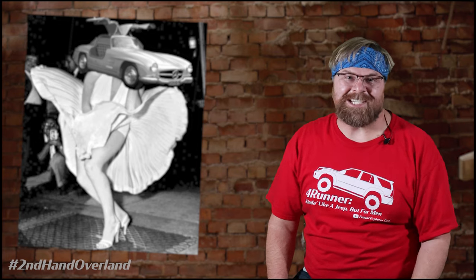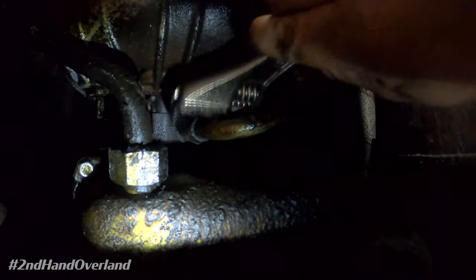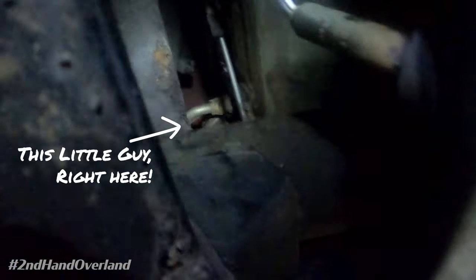Here's where things got interesting — disconnecting the lines from the transmission. You're going to want to keep the drain pan out as these lines are going to drain back from the radiator. Use a crescent wrench to disconnect the bottom hose first and use a drip pan below it to capture any drainage. The next step is probably the worst of the whole process — disconnecting that top transmission line. It looks tough to get at and it is, but I was able to do it without disconnecting the cross member or taking off the catalytic converter. Once disconnected, bring it down next to the other line at the drain pan.